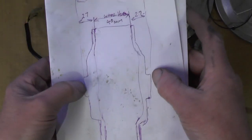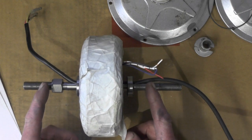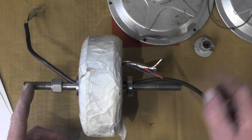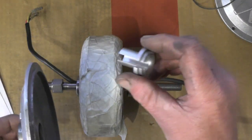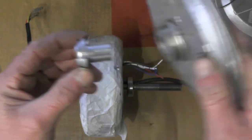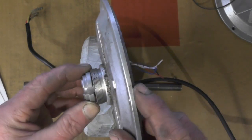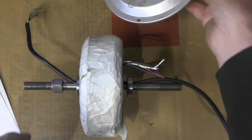I've done some working out on my width because I'm changing this from a rear hub to a front hub. I've got to chop the actual spindle down approximately 30mm on each side. Then when I've got the end caps fitted onto the motor, the original sleeve that protects the wires needs to be modified to a shorter length to accommodate my 100mm dropout on my forks.